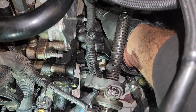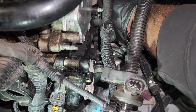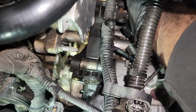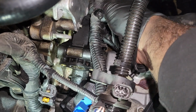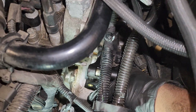The thermostat is not here. The thermostat is close to the alternator, but there's another model which has an electric thermostat fitted behind the head. But on this Kuga 1.6, it's a water outlet pipe. People call it the water bypass pipe to the heater hoses.